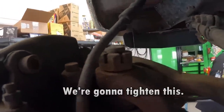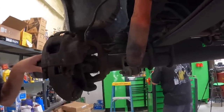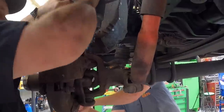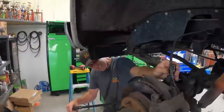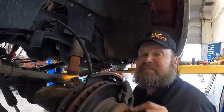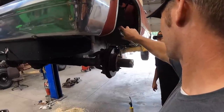One size fits all around. That's just bad — let me do some adjusting. That would have sucked if you broke the brake line. I was halfway expecting it to break. Hasn't even wiggled. Let's do the air impact. It never even moved. Come on, free all. You got a pry bar? I got the pry-all bar. I don't think it's moving at all — might have to put some heat on it. I think it's been sitting like this for a day or two. I see it bubbling in there, so that's good. Let's hit it with the free-all now and let it soak in.